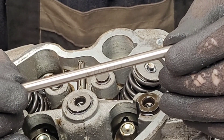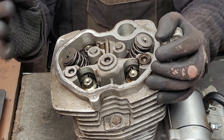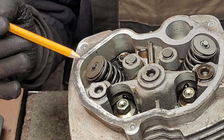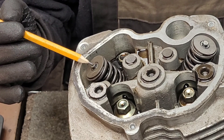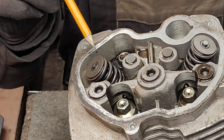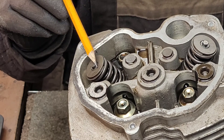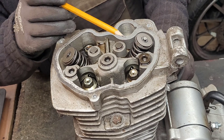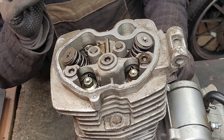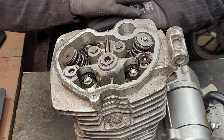This is a CG125/152 and that's because, to the best of my knowledge, this is a clone of an early Honda CG engine. Here at the top of the valve stem, and around the stem, are the valve springs. Valve springs are balanced to keep the valves tight against the valve seats but not so strong that the rocker can't push the valve open. For better performance we can fit beehive springs or conical springs which can help reduce valve float — valve float is where the valves close but they bounce off the seat before they sit tight.